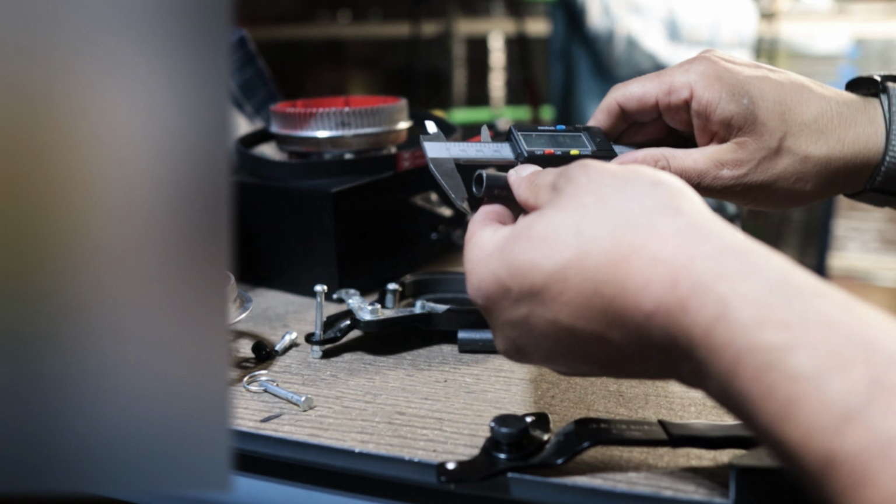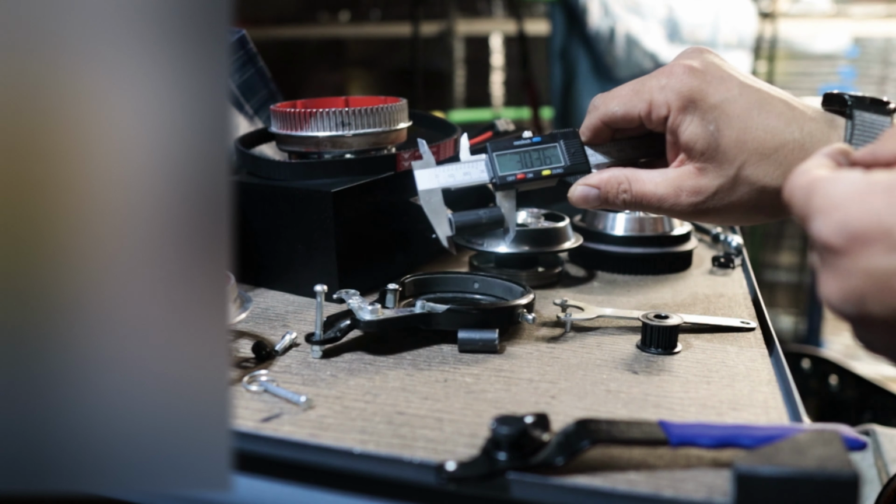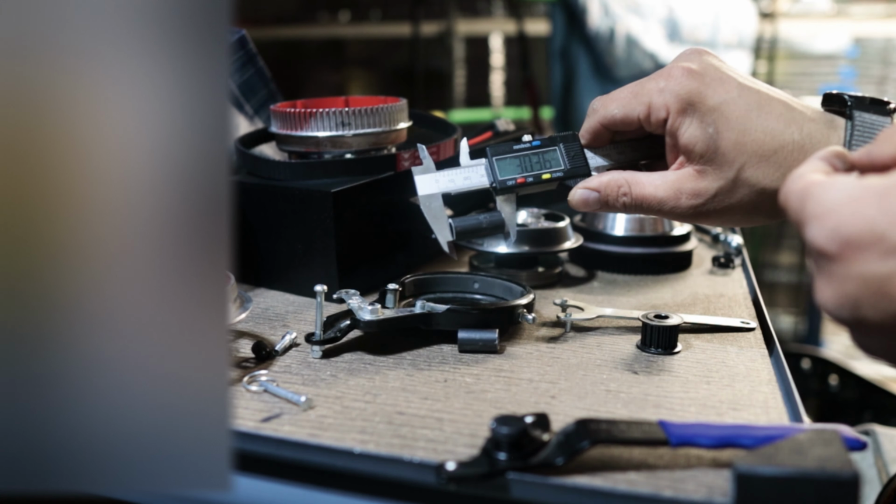So the spacer that's going to go on your sprocket side is going to be 30.36 millimeters. And the spacer that's going to go on your brake side is going to be approximately 25.12 millimeters. This is a sprocket for your motor. Again, we're working on brushless, so this is a 15 tooth, 10 millimeter center bore, 16 wide sprocket. I would recommend the round shaft 7070 Flipsky motor. And again, your belt is going to be a 550 5M with 15 width.